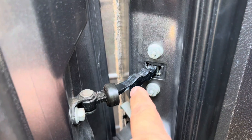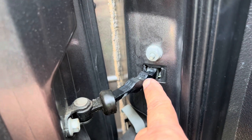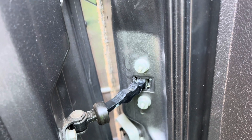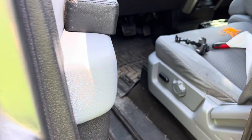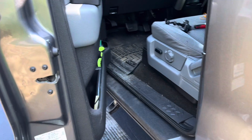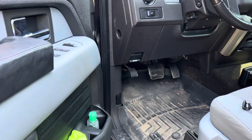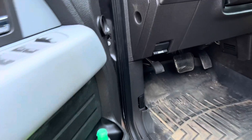What you see here is the very first detent. The second one right here is actually machined, and the third one is actually back in there, which is actually in a full wide open position. From Ford, there's your first opening of the detent and the only other one they have is completely wide open. What we do is machine that middle position, which allows you to easily have access to get into your vehicle.